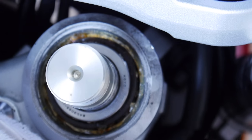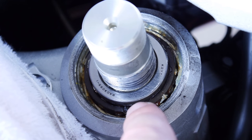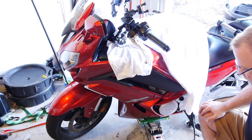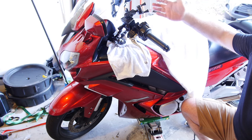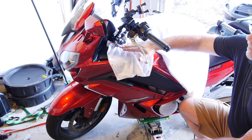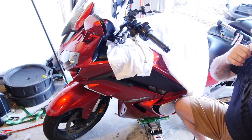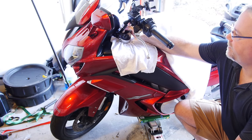Now we can drop the front end. The steering stem will drop through and that'll give us clearance to really inspect things and see the bearing on the bottom as well. As you jack this up, be mindful of the top plate so it doesn't shift around — everything is going to come up and you don't want anything scratching. We're starting to raise off the front end. Don't go so far that the steering stem pops out of the frame — we just need clearance to inspect and grease.